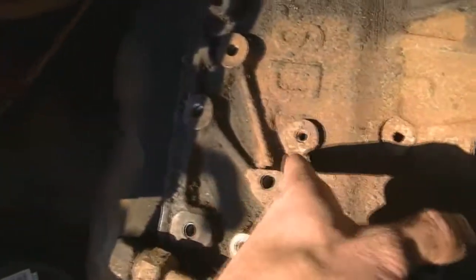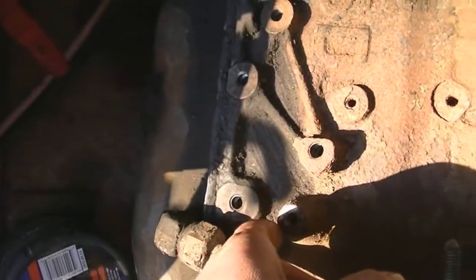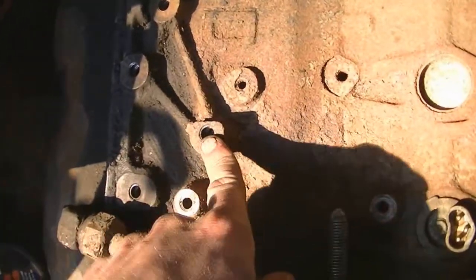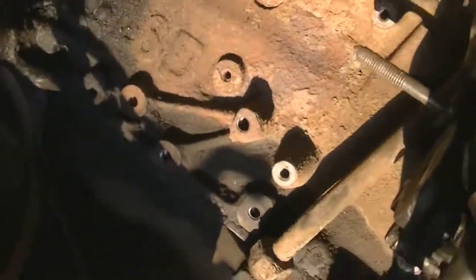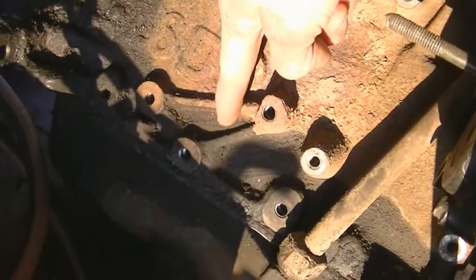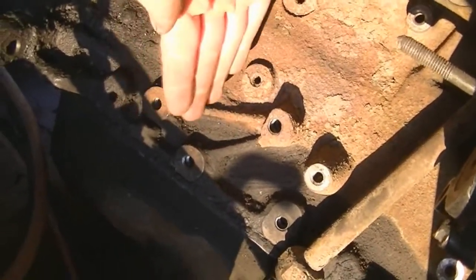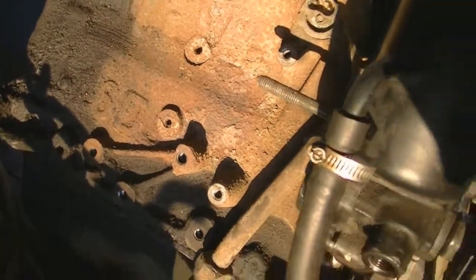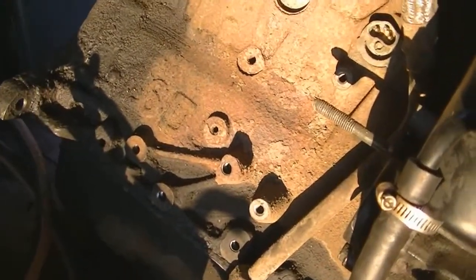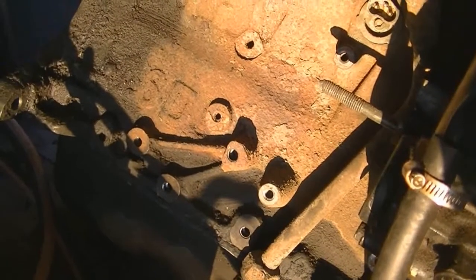If not, I can always make another tab. What I'm gonna do is run it like that, notch around it and around that one as well. If I do need the top bolt I can weld another plate onto it. I think I measured it and the motor mount is centered somewhere around here, so what I plan on doing is coming off here with a pipe or something. We'll see when I drop the motor in and see how she lines up.